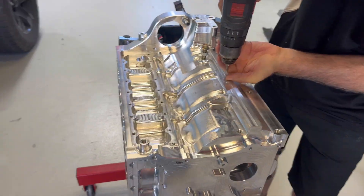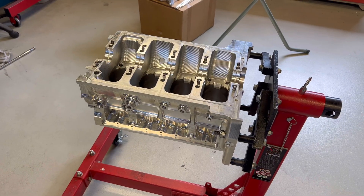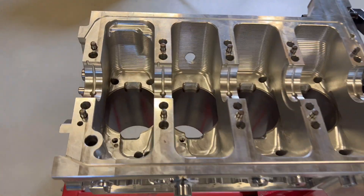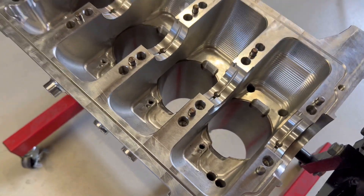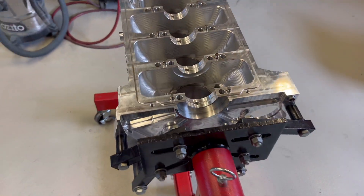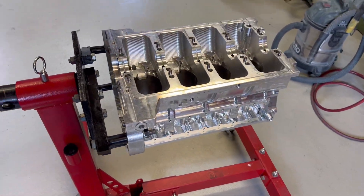Have to have Darren on about that — he should have put some spots in for us rear-wheel drive guys. So we've had old Donnie on the die grinder for the last few hours. He's tidied up all the bottom of the bores for clearance for the aluminium rods. He's also deburred the block. We've just pulled the main studs out. Now we'll take it outside and give it a bit of a wash.